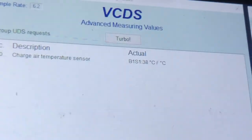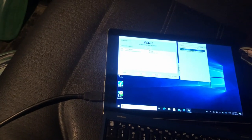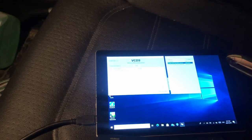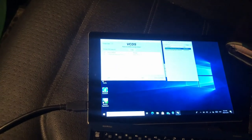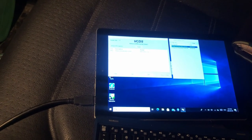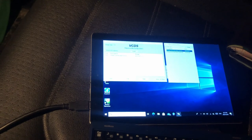So did a little test drive. Charge air temp is coming up at 38 degrees now, which is better than that 62 to 64 it was hanging around at. So I'm going to take a guess and assume if your sensor is stuck around 62 to 70, even when cold or warm, all the time — it's probably a bad sensor. Seems to be working good. I do have some cylinder torque difference codes coming up, so I think in the future I'll be doing a video on replacing injectors in this thing. So if you're enjoying the Passat videos, stay tuned for that one. Thanks for watching.